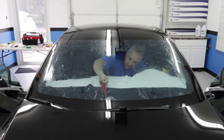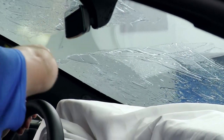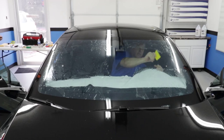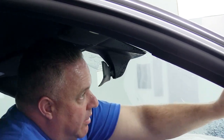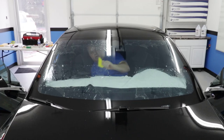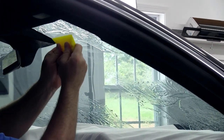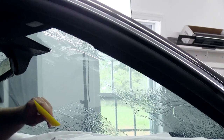The key here is not to get in a hurry. If you just get this right, you don't have to go fast — there's no hurry. I'll tell you something: if you're tinting a Tesla, I forgot that you've got to cut the top part almost dead even, or you don't have much room up there. I may have to do a little trimming — it's not going to cause any trouble, it just increases the chances of getting a little particle in the tint job. I actually tinted another Tesla and had the same problem and had to redo it because I got too much trash up in there for my taste.